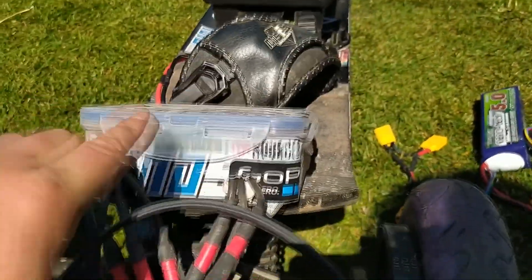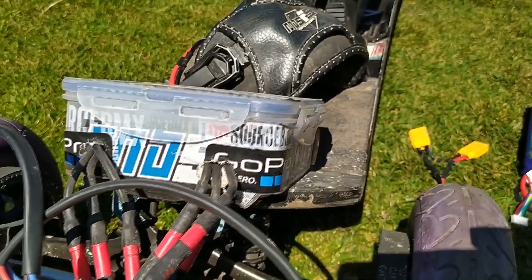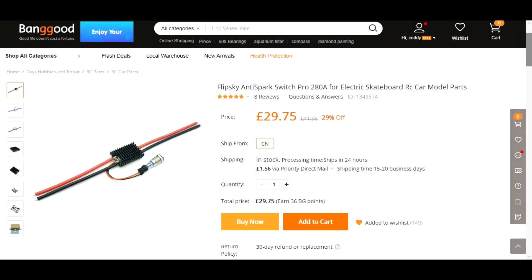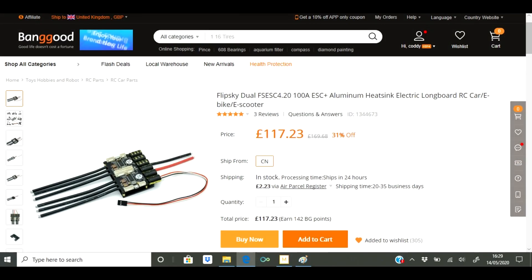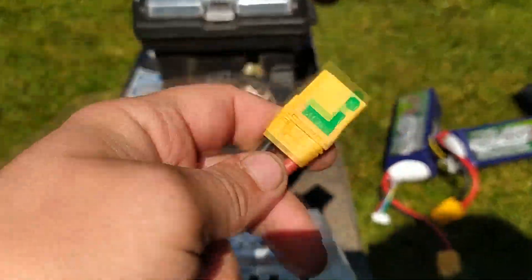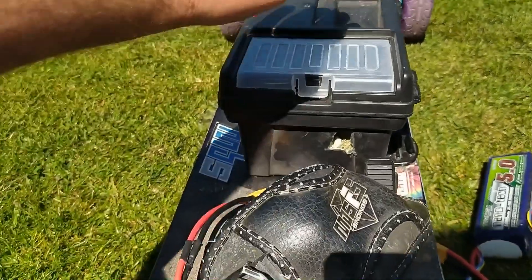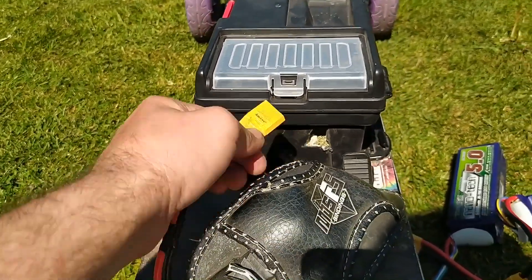I've got a high-tech piece of kit — a sandwich box, one pound. Stickers are an option, and they'll add about 10 miles an hour extra to your speed, so go for it. Inside there I've got my Anti-Spark, FlipSky 4.2. With regards to the Anti-Spark, I've got an XT90 Anti-Spark — it's a lot cheaper, like £2, instead of buying a switch. It's a bit of a dodgy risk though. Then a super high-tech box, costs 3 quid, to put my batteries in. Then your power lead next to there.